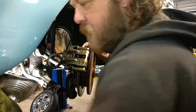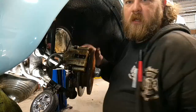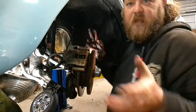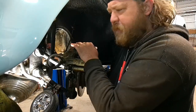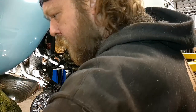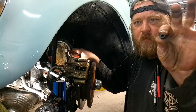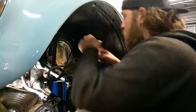You definitely probably can't see what I'm doing back there. I like taking the retainer clip, the little line clip, whatever, off first, because then nothing's really flippy floppy. Because once I get this brake line off, I'm gonna shove a... I lost it. Where did you go? Try to save on some fluid loss. Once I get this line off, just boop vacuum plug on the end of it. Hopefully minimize it from dripping all over the place.